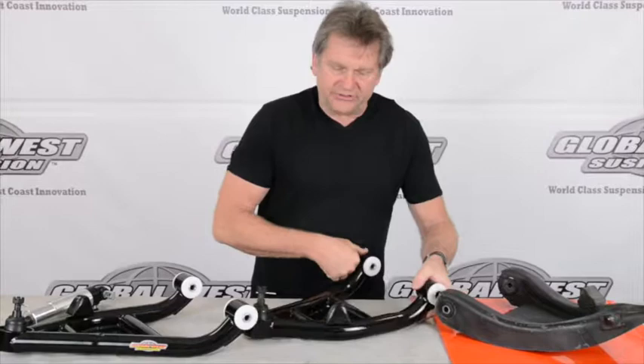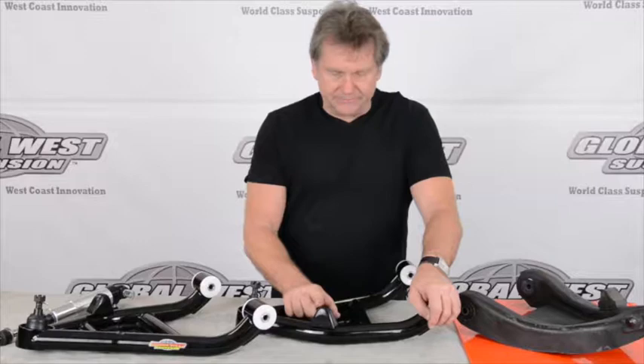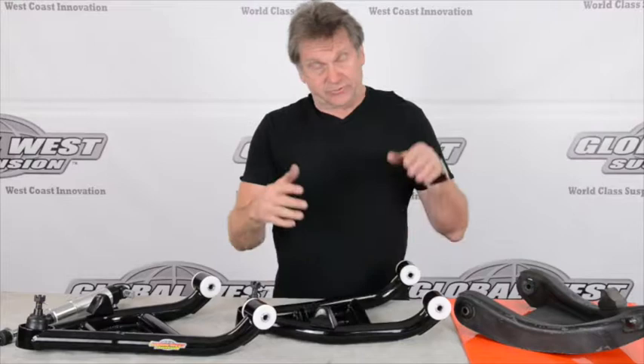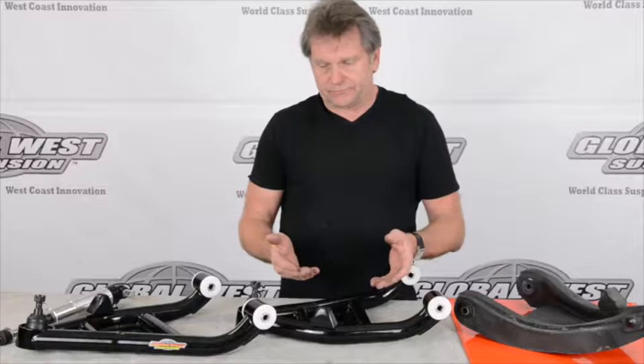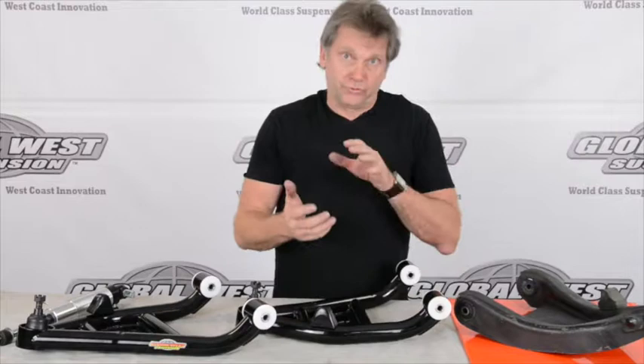This also has a special bump stop. This particular bump stop is a rising rate bump stop, so instead of having something come down — like if you do a wheel stand and you hit the frame with your bump stop — you get a really hard impact. This one is progressive: for every quarter of an inch, it increases resistance by 100 foot pounds. So instead of hitting the frame hard, it's going to roll off of it. The load is going to be applied, the rate's going to go up, and it's going to allow you to cushion off that rather than it being such a rigid hit.